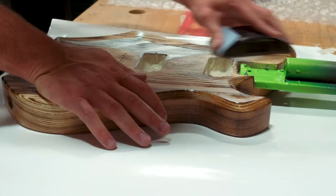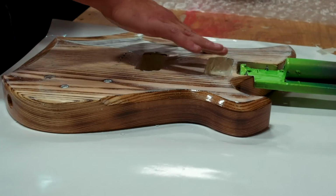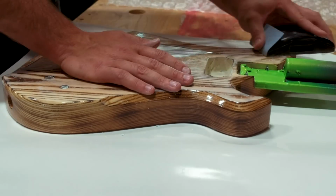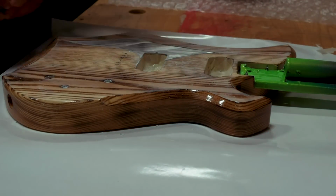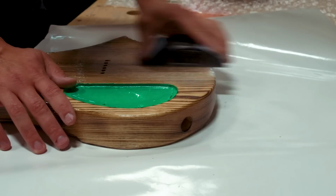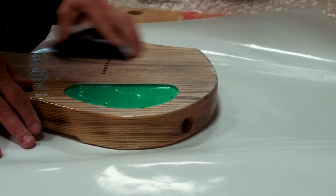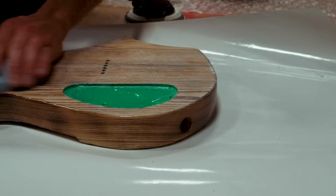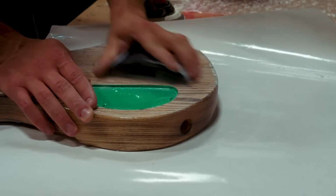Some people seem to think that they should be sanding with 2,000 to 3,000 grit between coats. Unless you're working with lacquer, you should not be doing that. The next coat of paint just won't be able to stick properly. It needs something to grip onto, and that's why we sand, to make sure that we've got that abraded surface that the next coat can grip, because after 24 hours you're not getting that chemical adhesion anymore that you get between coats during flash time. 10 to 15 minutes is your general flash time like we just talked about, but if you wait longer and you let it set, you have to sand it so that the next coat will stick.